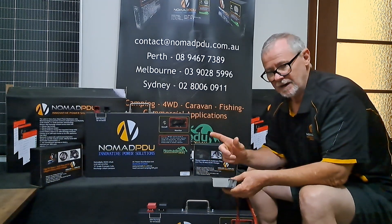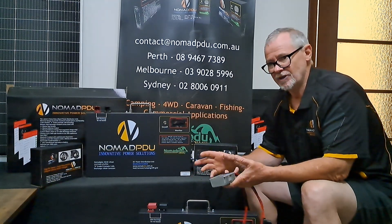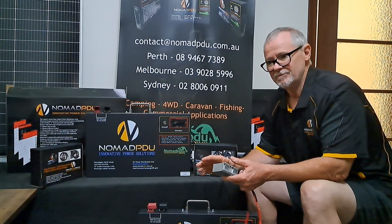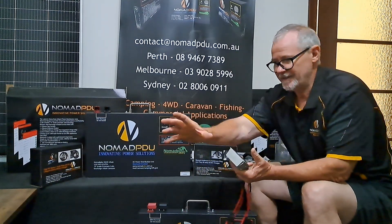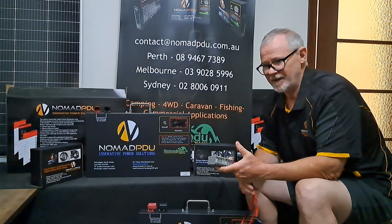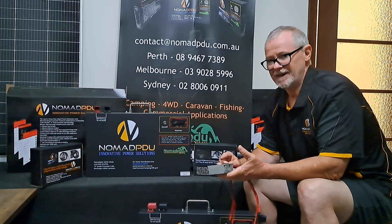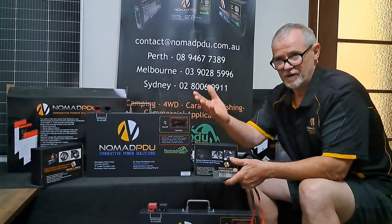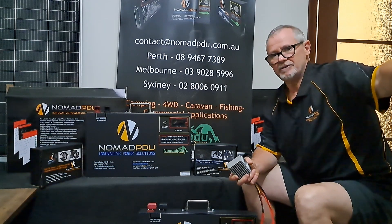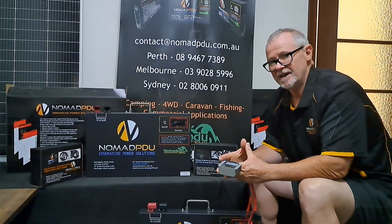The DC-DCs that are really popular now — and I've used myself — are DC-DC units with solar input. That takes all the guesswork out: you buy one that says 'DC-DC with solar input,' plug your solar panel into it, and it regulates everything to whatever the DC's set output is. I'd mention the Mattson T21 and there's now a Mattson 40 — a 40 amp unit that can charge LiFePO4, AGM, lead acid, and gel. If you come across someone with a flat battery, just press the button, scroll across, and charge their chemistry too.